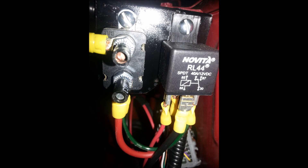Here's a close-up picture of the components and the wiring. I tested the circuit and it works perfectly. With my camper's refrigerator running on 12 volts DC, it pulls about 12 amps. When I checked the charge at the battery, it was at 13.53 volts and pulling right at 15 amps to run the refrigerator and charge the battery. So the circuit is now working.